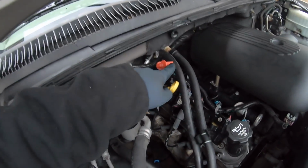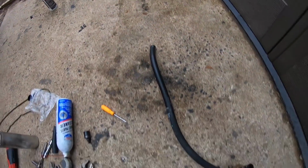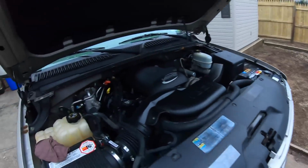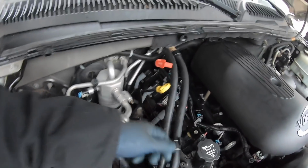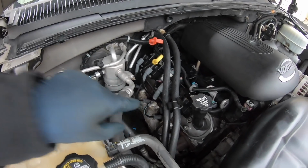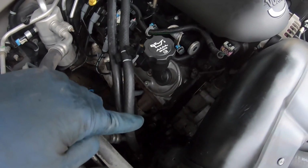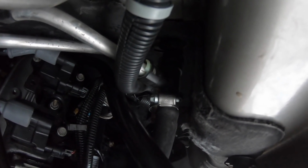Other thing is, I had to replace the coolant line because the one over here, after that piece snapped off, was just way too short, and it was putting too much pressure on the plastic T over here, trying to stretch it over, and I couldn't get it over the lip. So I had a piece of 5/8 hose laying around. I put a new heater hose on there, fresh clamp down there. I got rid of the spring clamp, and I managed to get it all the way over that lip